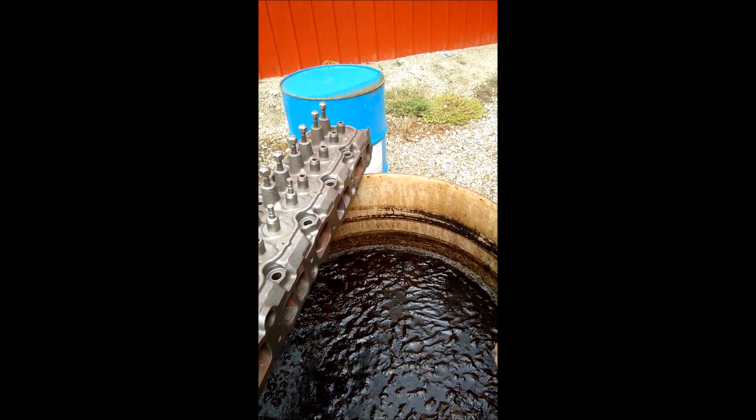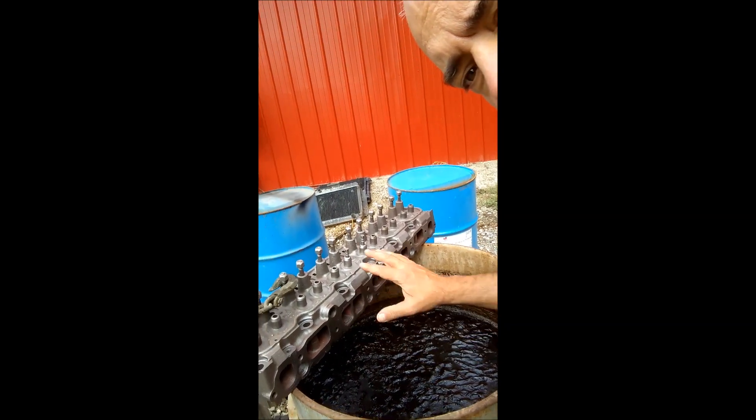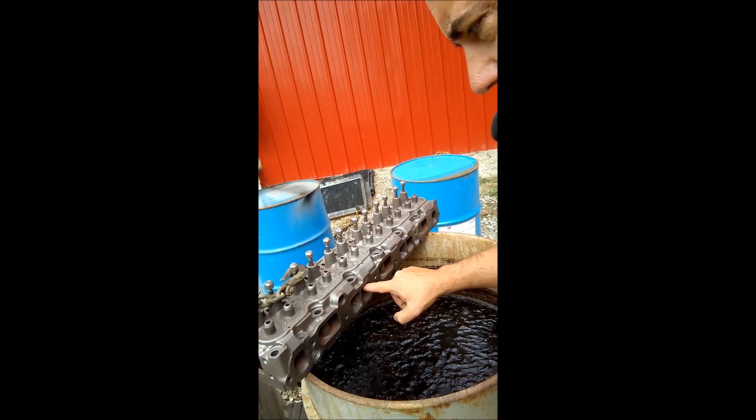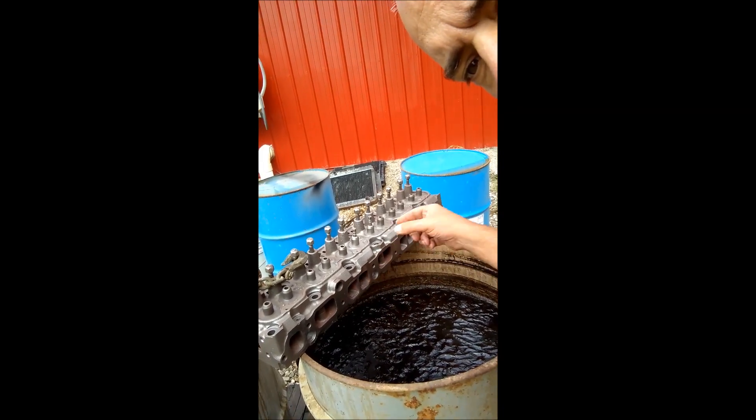The rest of it's water. And I'm going to dunk it in here. I'm going to come back in one week, pull it out, and see if these valves come out of the head at that point in time. We'll see how this scaly rust works out for us. The molasses works good to do that.